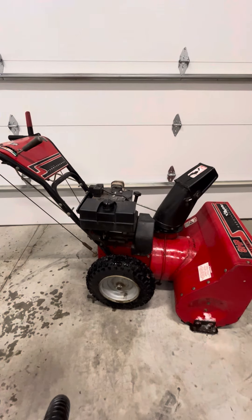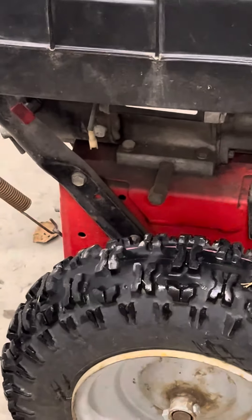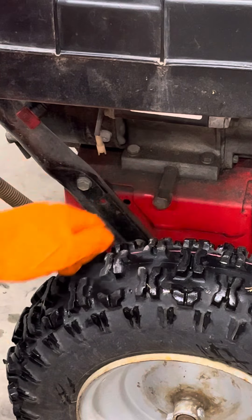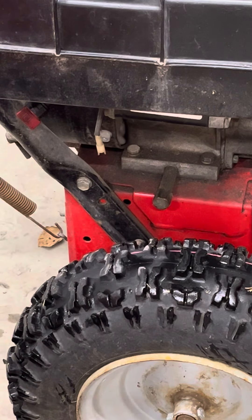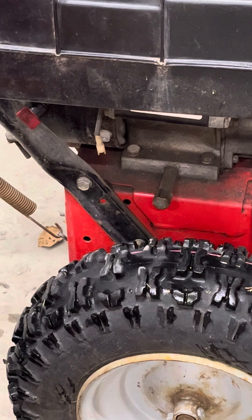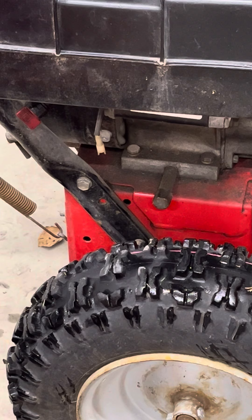I'm going to show you the hard way to do it first. If you do not have a pump, what you're going to do is right over here on the engine on the side — you see that little tube coming out the side? This tube right here is the drain plug for your snowblower. Get a wrench that fits that; looks like about a half inch on mine. Your drain plug may be in the back or maybe on the other side — it just all depends on what snowblower setup you have. Make sure that you have some kind of drain pan or funnel to put underneath this to lead the oil where it needs to go. You need to catch it in a good catch basin and dispose of it correctly. Most of your auto parts stores will take the used oil.